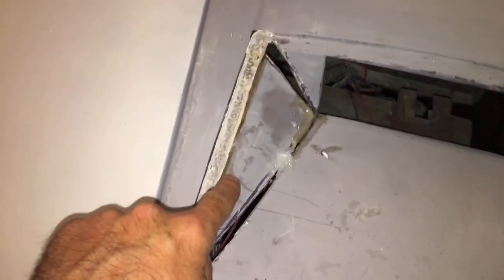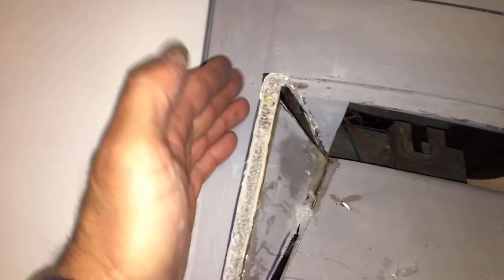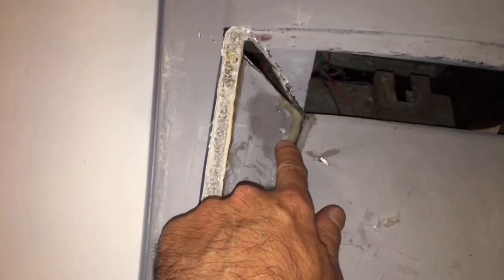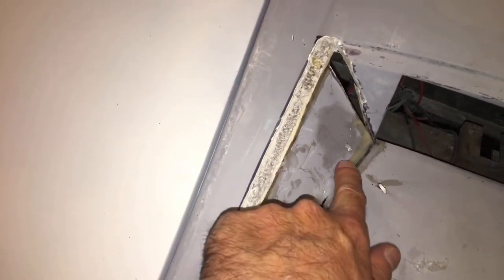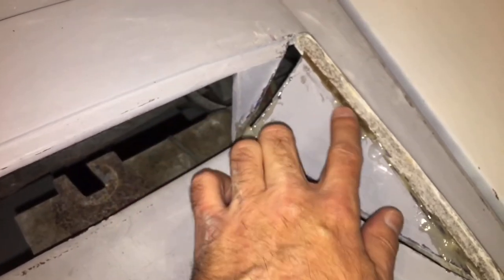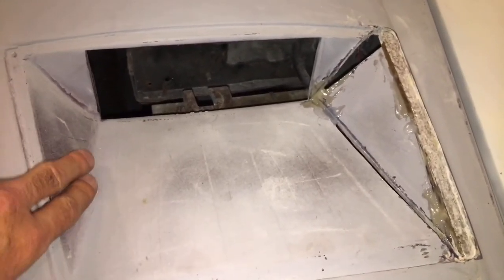Just finished epoxying in this piece here with the JB Weld compound, and you can see where I cut it off here. We took the angle here, routed this out to the edge so it's in line with the pop-up headlight. The side wall is now moved over approximately about a quarter to a half an inch right there. What I did is I just put the compound - which has a 15-minute dry time on it because this is the higher PSI version - and then I took a glue gun and put a little glob of glue here and here to hold it in place while that dries. Let's head over to the other one - same thing here. This one's still a little bit tacky but almost completely cured. This one goes more on an angle, and same thing - it's in line with the pop-up headlight.